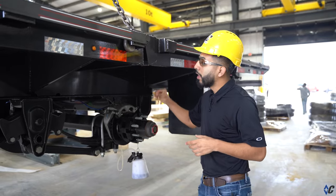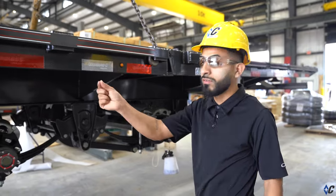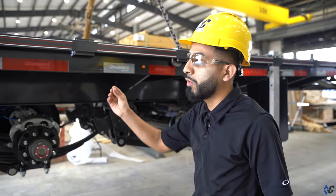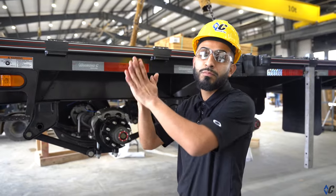The reason we start on the rear axle is to make sure that we push our air bubble back to the reservoir. You start on the rear, then go to the passenger side front, and then to the driver's side front — working your way back to the reservoir to ensure that air bubble is pushed back up.